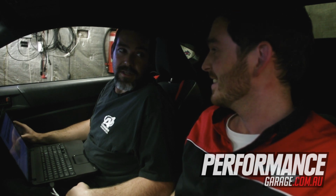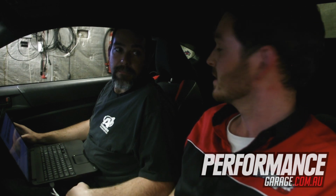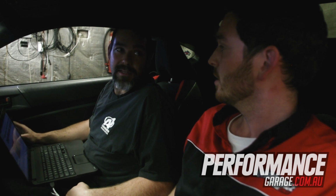Alright, we just finished up power runs on E85 with a top score of 211 kilowatts at 8 PSI. You happy with that? Oh, stoked. That's more than what we wanted, more than doubled the power output, so I'm sure the owner will be very happy. That's with the Haltech, the E-Flex fuel sensor, standard catback, slightly bigger injectors, and that's basically it, and obviously the turbo kit. Yep, and we'll do a catback on it in the next few days and see what happens after that. We're going to take it for a drive, so we'll see how it goes.